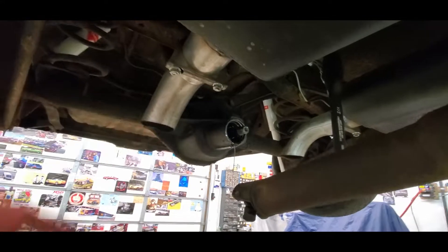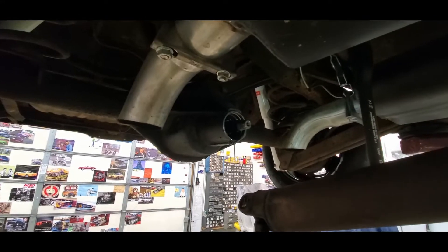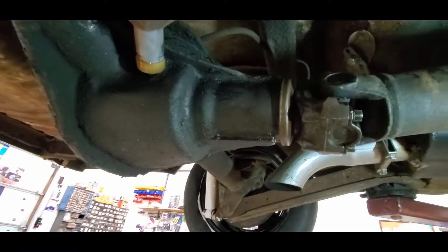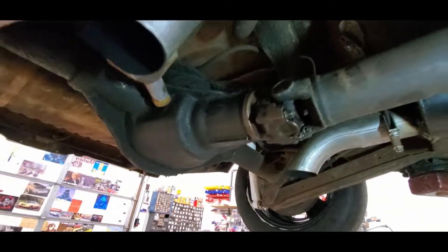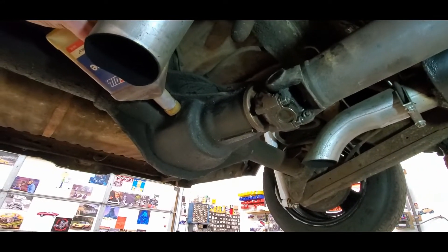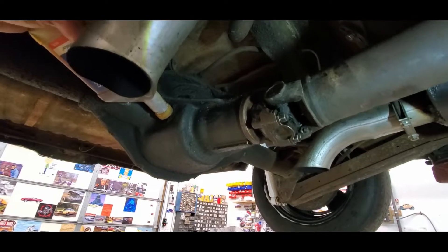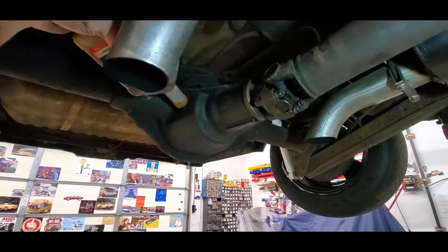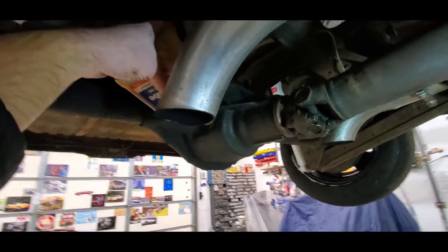There's no point installing the seal until it's done dripping — you really need all these surfaces to be clean to get that seal to work. Got her back together. She's not dripping yet, but we're only just now filling her back up. We took a wild guess on the preload. If this bearing doesn't live very long, that's fine — the rear end is on its way out anyway.